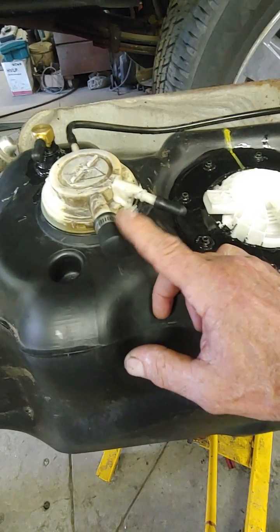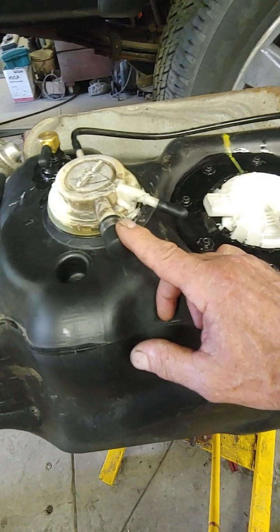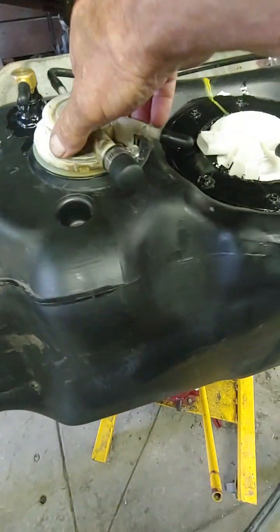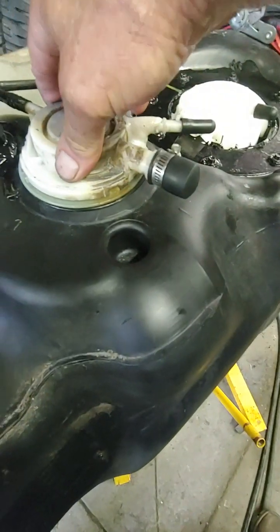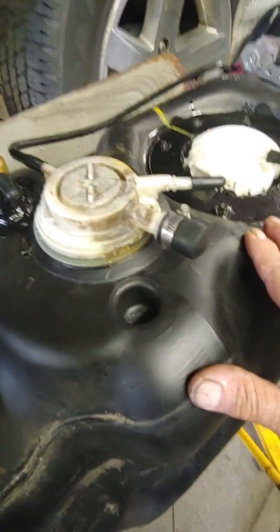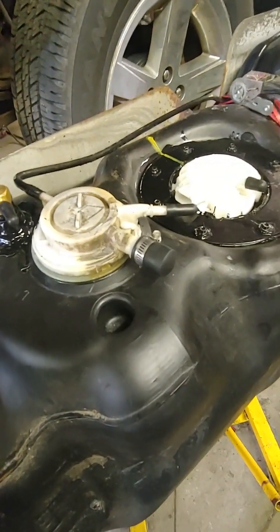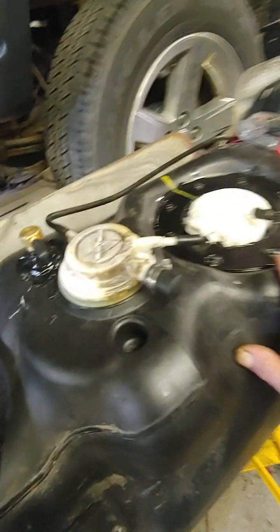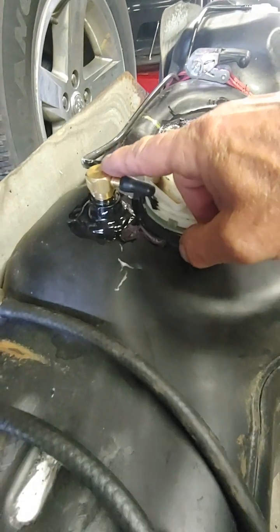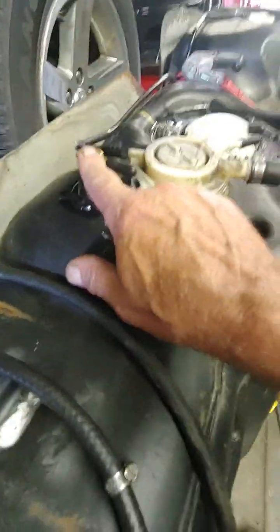And then when you want to get going again, the truck opened the purge valve to the intake manifold, and it floods the intake manifold with liquid gasoline, and the truck stalls. Now that I can find out, this rollover device is not replaceable. A new tank was over $900. I could not find a used one at a junkyard, because I would have done that. It's only $80. What I resorted to doing is I found this aftermarket rollover valve on eBay. It's $15. And I plugged the original vent and I used this one now.